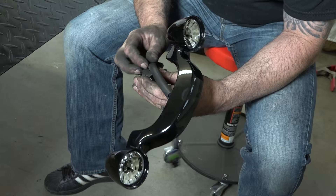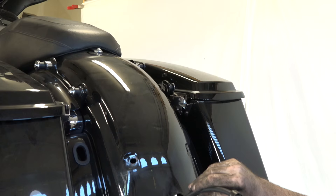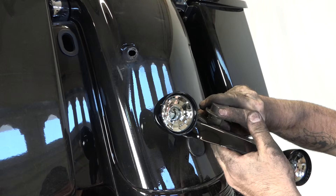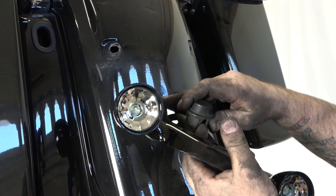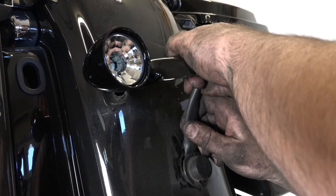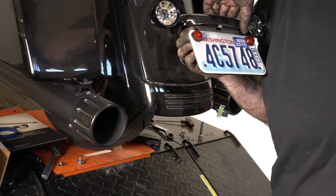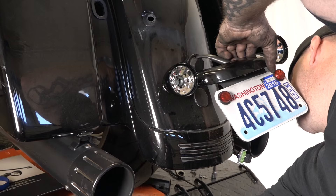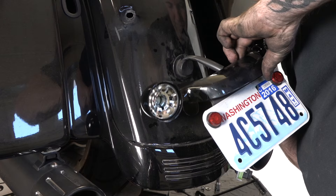Chewy's putting that rubber guide through the fender and putting the clamp back on. All this stuff can be slid around to adjust it as needed. Now he's guiding the wire through the fender, then he'll figure out exactly where the rubber grommet needs to go — just adjusting it back and forth. You don't want a bunch of extra wire outside the fender. We're going to get the two Torx T27 bolts on the license plate cover and get that back on before actually bolting it back to the fender.